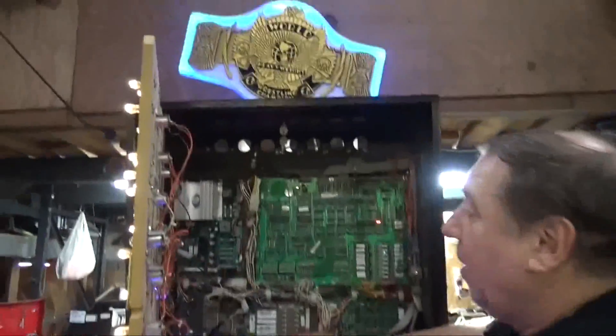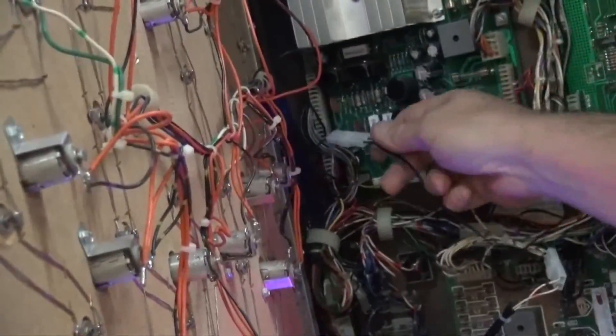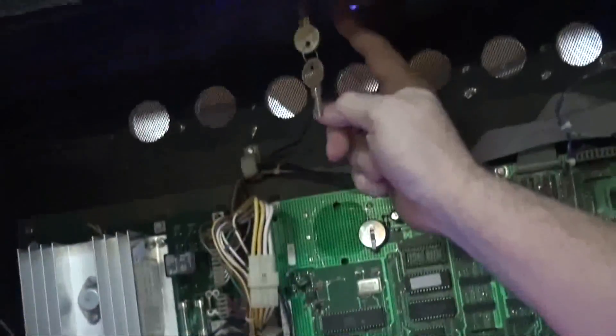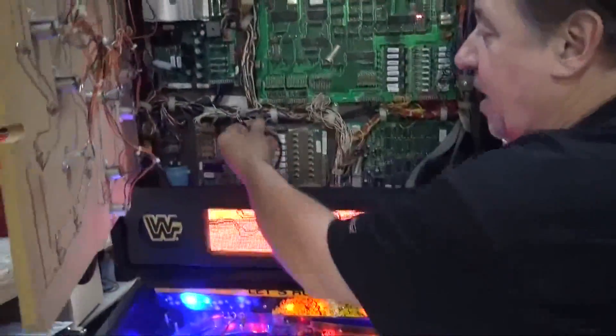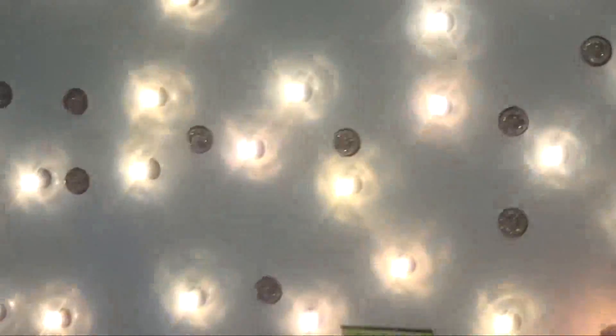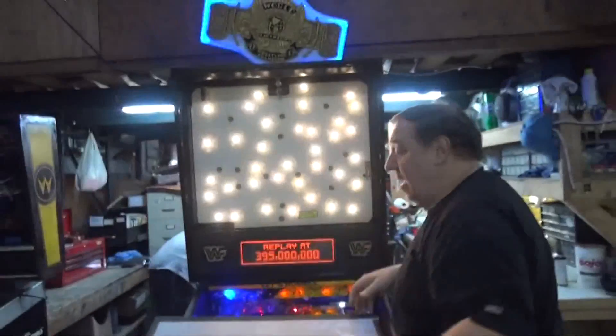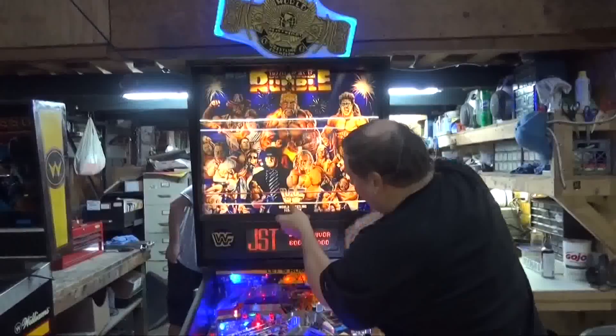He had to add it. The LEDs are patched into the 12 volts over here and they go up through a hole he drilled, and the lights underneath are patched into a connector here. So if you had to unplug these and take that out, you can — everything comes apart. We like everything restored close; that makes it so nice and neat.